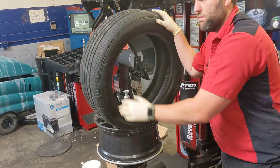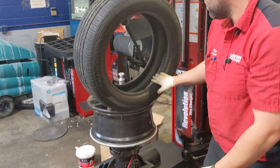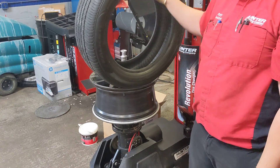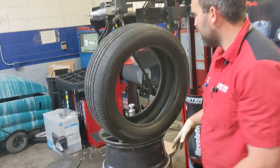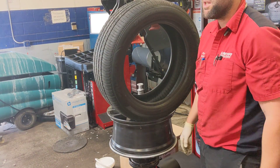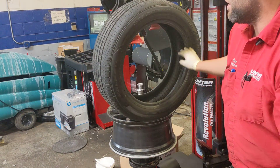This tire is already pretty loose, but just move around the bead nice and good. Don't put a ton on — I used to think you had to put a ton on, but as soon as you start doing this it'll rotate and sometimes will spin on the wheel pretty much. Just put a little bit on the bead.